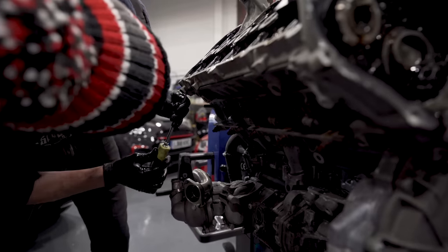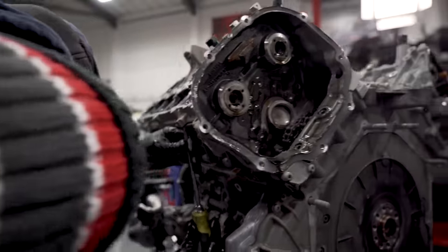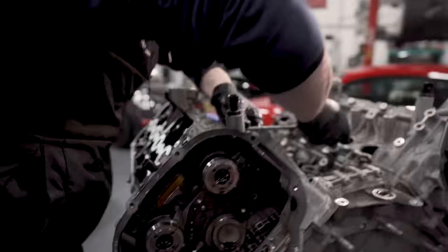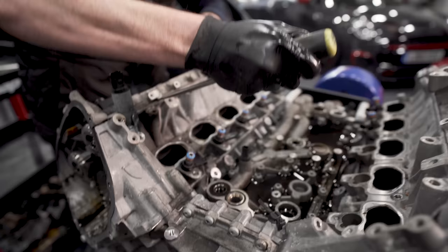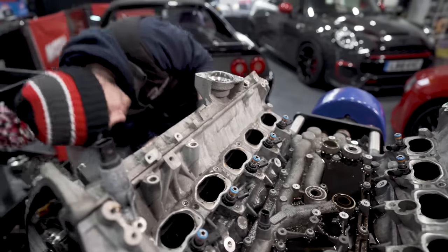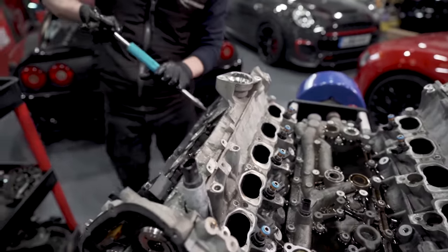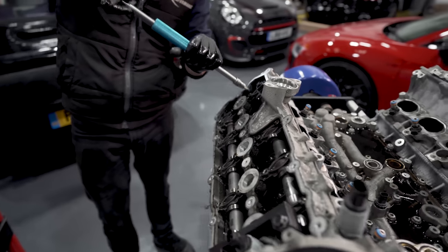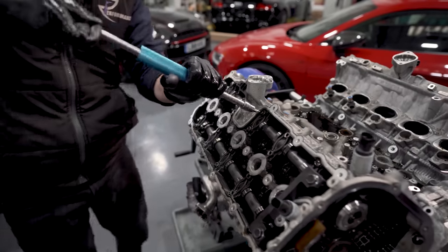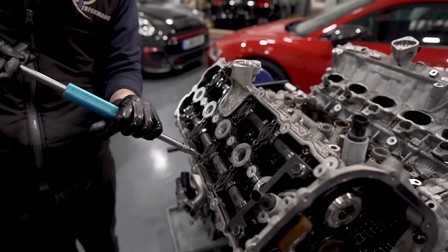So there are set points that you can do this? Yeah, where you're not having to lever on the mating surface. They've got little right angles on them. There you go, you see? So you've just got to go in the right place. It's in the workshop manual. There we go. Now we're going. So now we've started to break that. Still got a little bit more to break this end, I think. But it will start to come away under the control of the screws.